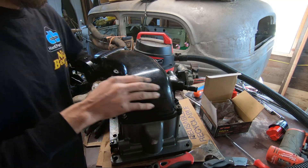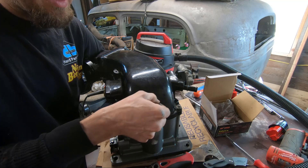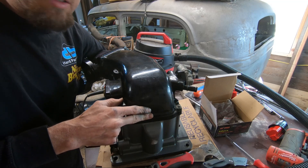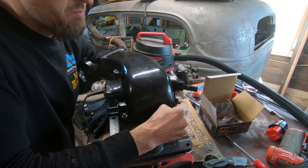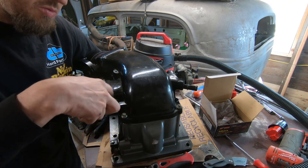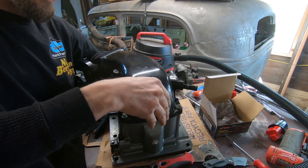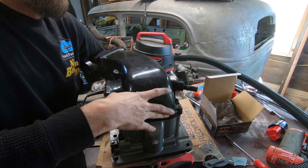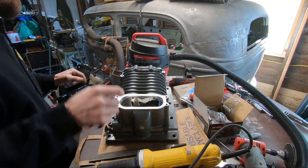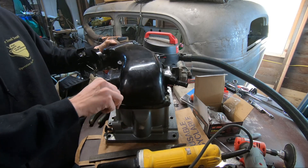This has already been ported, so I'm actually feeling up here with my hand the areas I'm gonna have to lay out. I'll put a marker all the way around it so I can port the supercharger plenum — it's going to be a little more difficult. Now I know where I need to port and where not to. For instance, this side where the radius is lines up really super nice. The one on this side on the bottom needs to be ported around the radius; the back also needs a little bit, and then the front. So everything except this one side basically needs to be taken back about a sixteenth of an inch, maybe a little more.